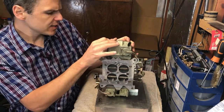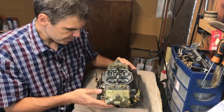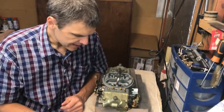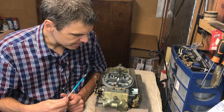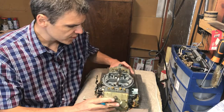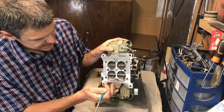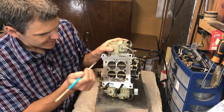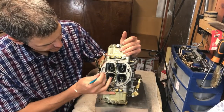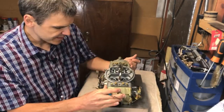The good thing about these plates is that they can fit pretty much any 4150 or 4160 carb. This one in particular is an 800 CFM, which is quite a rare carb to get. It's the biggest flowing carb that uses the 750 CFM plate — this plate is rated 750, but because of the size of the venturis, in Weber terms this is an 800 CFM carb.